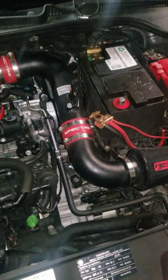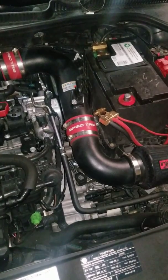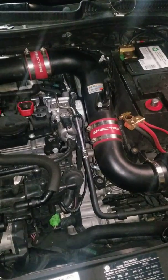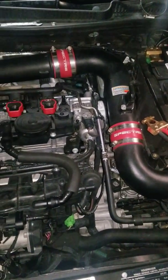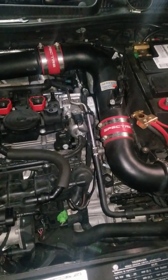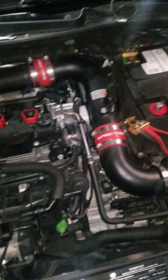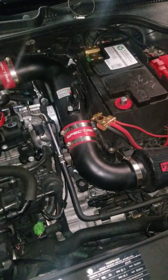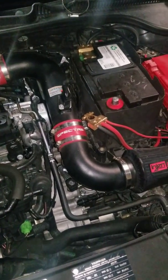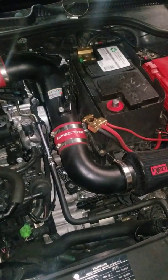For diagnosis, this will help you diagnose any alternator, and there's one part specific to certain alternators I'll go over as well. You'll just need a voltmeter. Test at the battery when it's running. If your alternator is running properly, you should be seeing anywhere between 13.5 to 14 volts. You don't have to check amps or anything like that — just look at voltage. If you're within that range, your alternator is doing good.